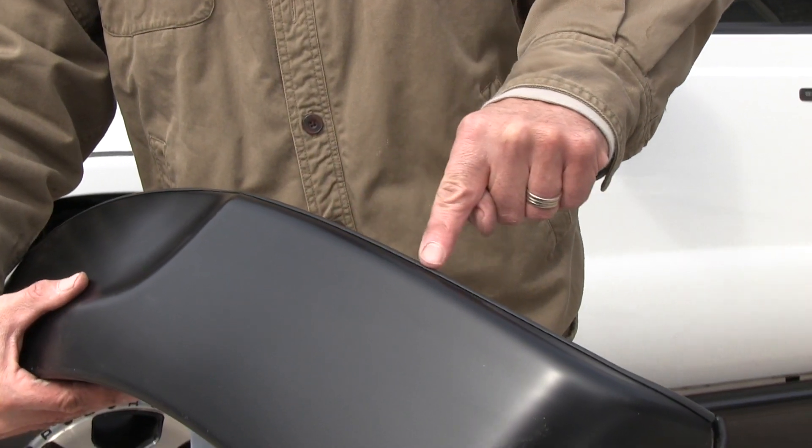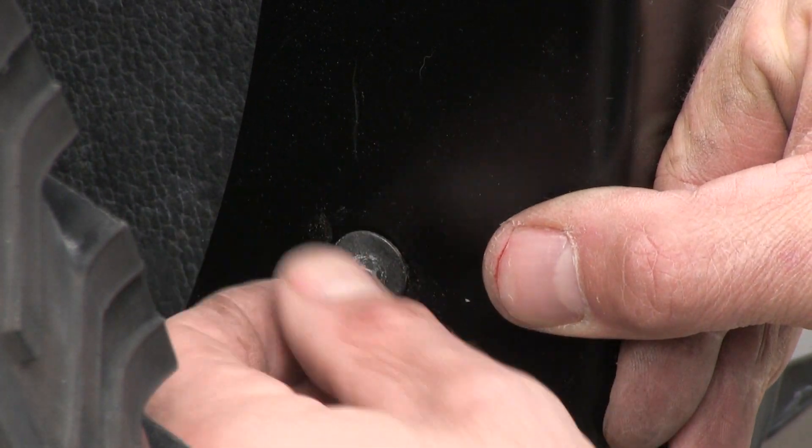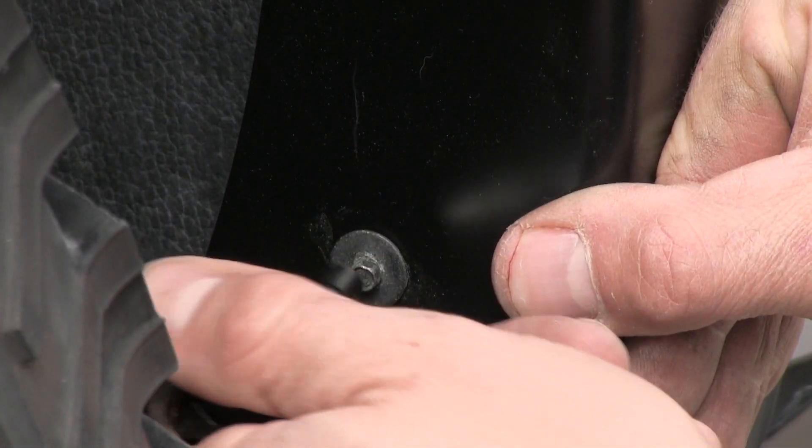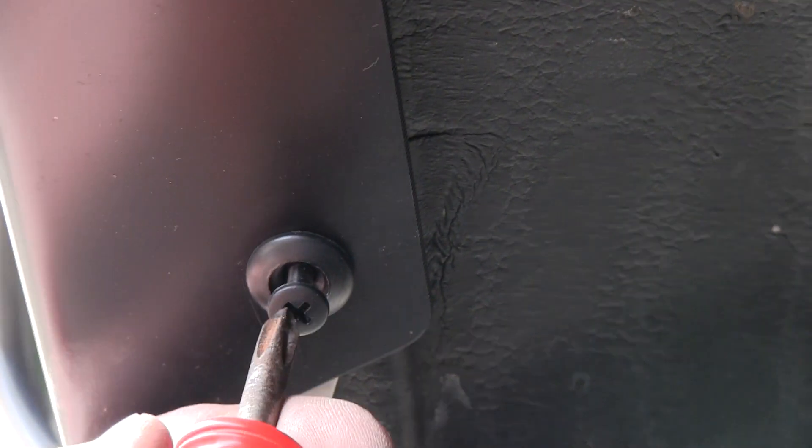This protects the paint on your truck. Now you attach the fender flares by using the existing factory holes and simply screwing the flares into place. For the front flares on our Ford F-350, you'll use a combination of tough lock fasteners and the screws used with the stock fender flares.